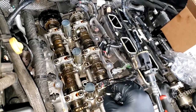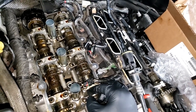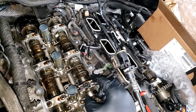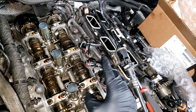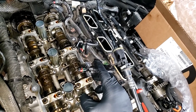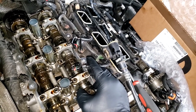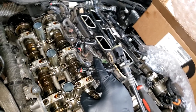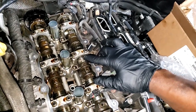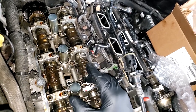Okay, now I know a lot of you guys would get upset with Chrysler for making us do this. Guys, everything is cost efficient. Everything, they gotta watch the dollars around here. So I'm not sure if them letting us replace all the rocker arms is a bright idea. I mean, if nothing's wrong with them, why replace them? It's the way they see it. It's a sensitive topic, okay? So I don't know which way to call it, but if it was my car, it's getting them all. I didn't say lifters, I said rocker arms, because those are the ones that are known to break. But this cam lobe is missing, and I really have to replace this bank 1 intake camshaft.